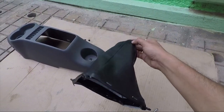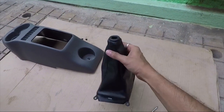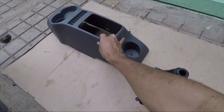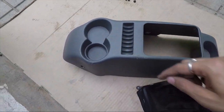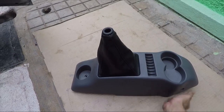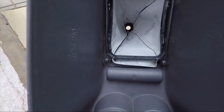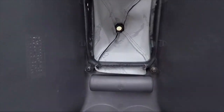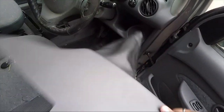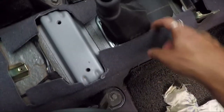I got this stitched at a local seat stitching store. You can do that too, or get a spare from the local spare parts dealer in your area. Now let's fix this back on. I've cleaned up this whole section as well with a good clean cloth. This is how it looks once it's done — I've put all four screws in and tightened them up. Tighten them properly, but since they are plastic, do not over-tighten. They will hold on fine with less force.